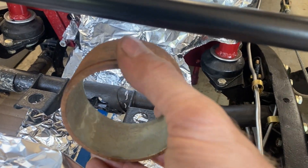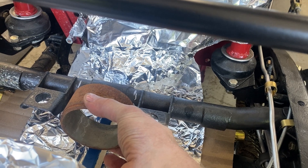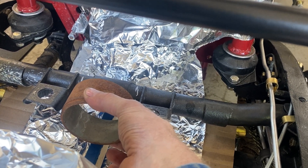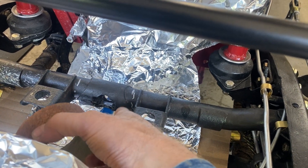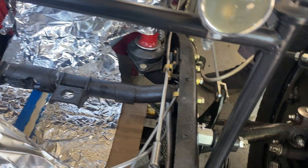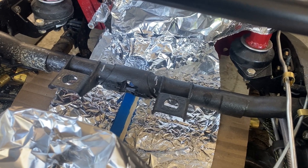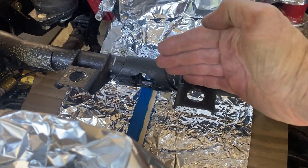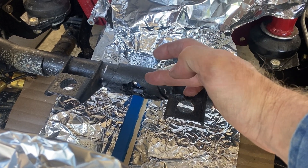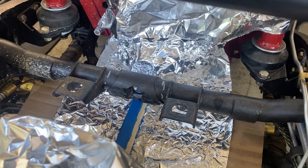Our fix for this opening is going to be this guy. It's about two and seven eighths, two and three quarter inside diameter, so that gives us some room. We're going to insert this where this old piece was, welded in position — that'll give us tons of clearance for our new supercharger U-joint. The other thing we have to be careful of is the radiator comes across here, so anything that extends beyond this height has to be back further; otherwise we're not going to clear. We're going to make a provision for that too.